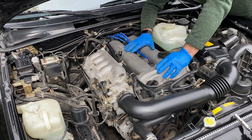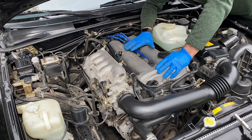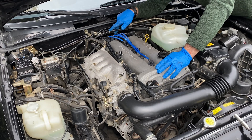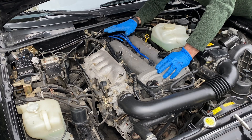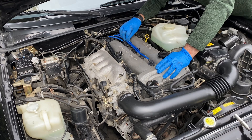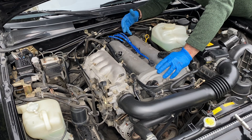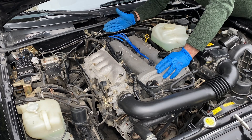Now if you have a 99 or 2000 Miata, the weak point on these is the coil pack, and when it starts to fail it can run rough, misfire, and throw that specific code. This car is low miles and it's just had a new set of plugs and wires, so we know it's not those. The next thing to do is the coil pack, because eventually they go bad anyway, so we're going to put that in today.